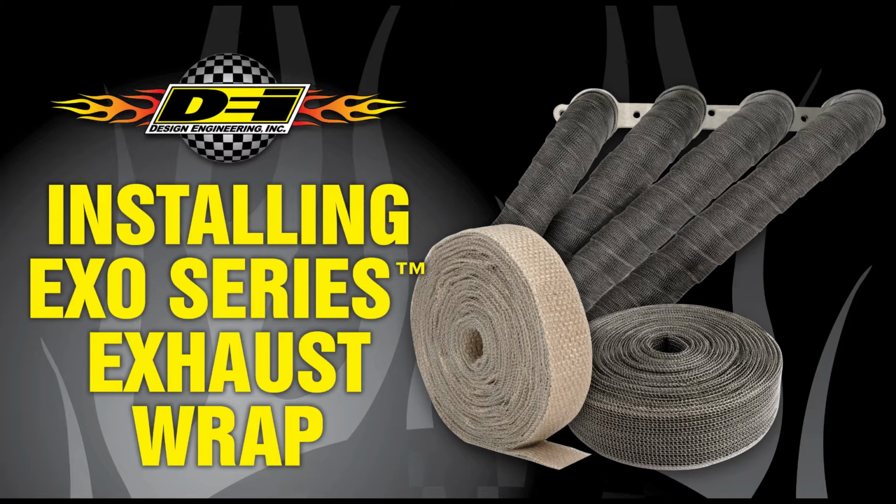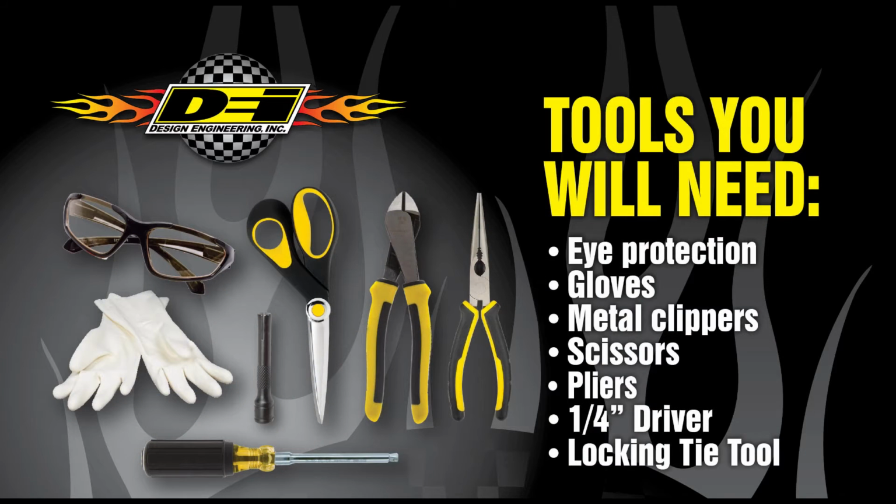This video will show you the right way, some tips and tricks on wrapping a header with our tan or black EXO Series wraps. A few tools you will need to complete the install are eye protection, gloves, metal clippers, scissors, pliers, a 1/4-inch driver, and our locking tie tool.